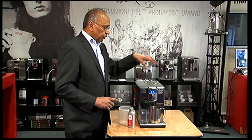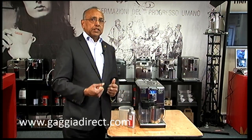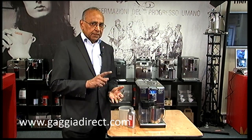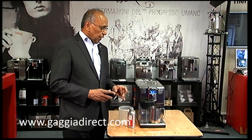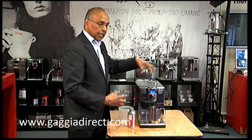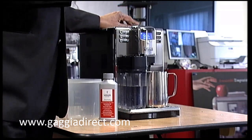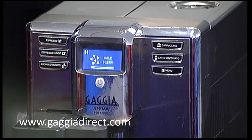The other thing you need to do is regular maintenance of your brewing unit. Once you've finished all your descaling, it's a good thing to take out the brewing unit and give it a good clean, which you need to do every week. You also need to lubricate the brewing unit from time to time — there is another video showing how to do that on all our automatic machines. You also need to do a degreasing, because coffee oils can get blocked within the dispensing arm as well as on your brewing unit. You can do the degreasing with some tablets, which you put in through your pre-ground chute and do a rinse cycle.